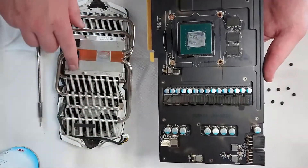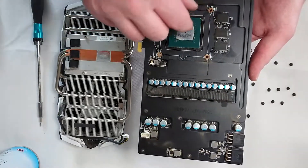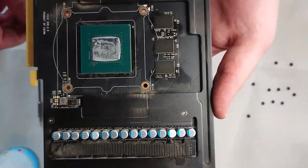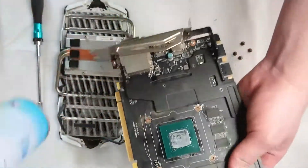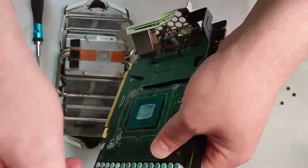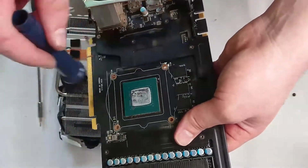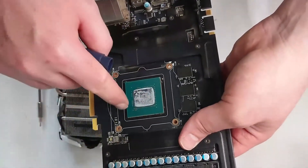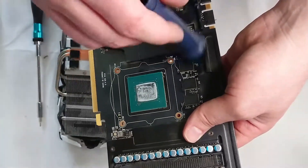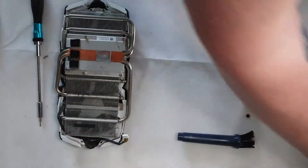These little components here next to the GPU die — you'll want to be very careful with those. I'm just lightly brushing with this cleaning piece and I'm going to avoid touching those as much as possible. I use both a little electric duster — this thing cost me $70 on Amazon — and I also use some air in a can just because it has a higher pressure and tends to get into certain parts a little bit better than the duster. A combination of both seems to work perfectly fine.